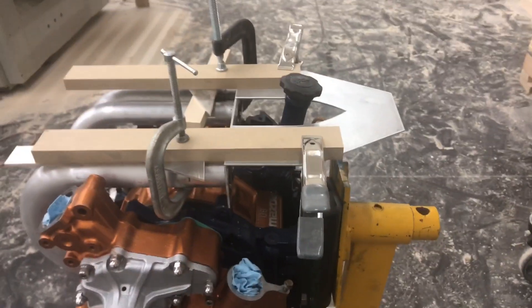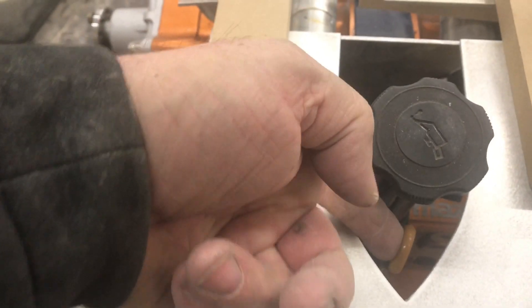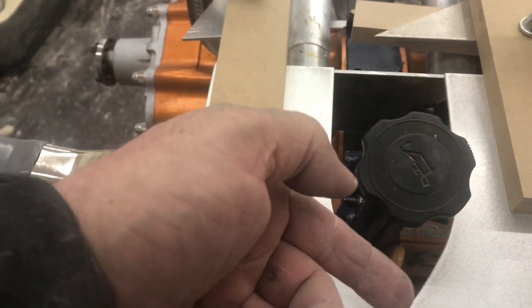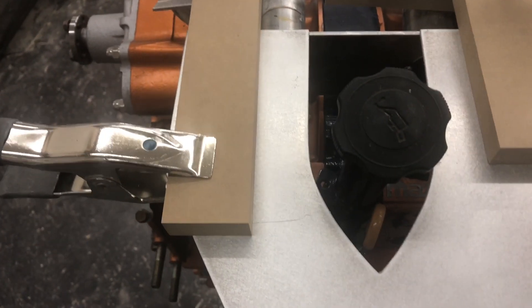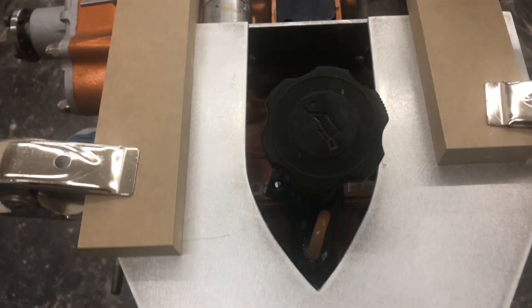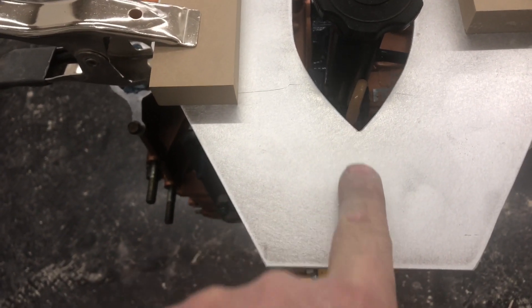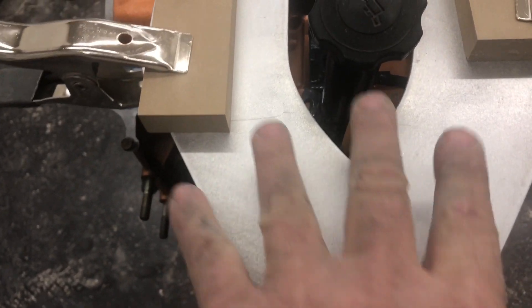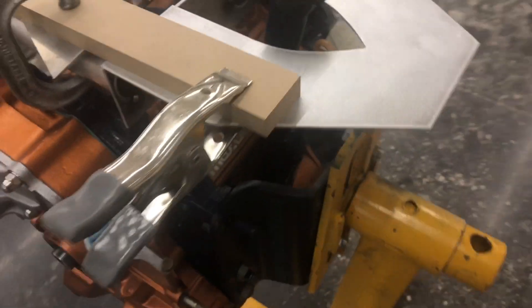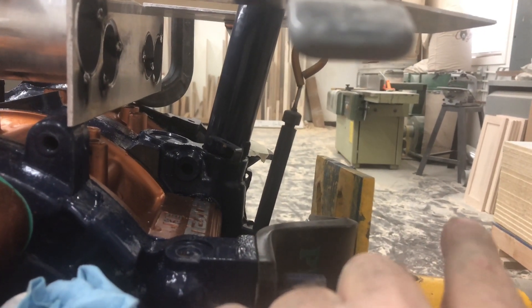Now I'm working on the plenum box. The plenum box is a little bit difficult because I have my oil fill and also my dipstick down here. I've ordered an extended dipstick that will be up higher so I won't have to reach down in the hole to check the oil. This is forcing me to have a split plenum box, and I've got to make sure my throttle body is perfectly centered on this V so that when it hits it gets equal flow both directions. At the bottom I'm going to have to bring the plenum box out to this corner and fade it down because I need four inches here and I only have three inches here.